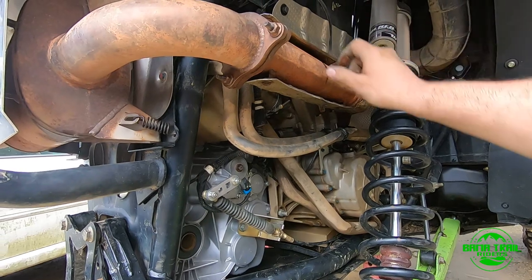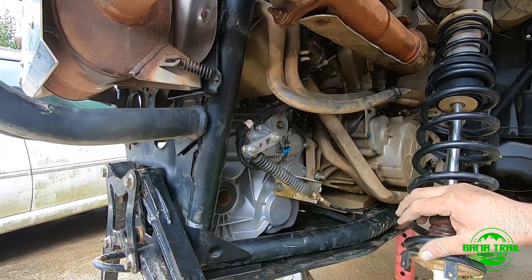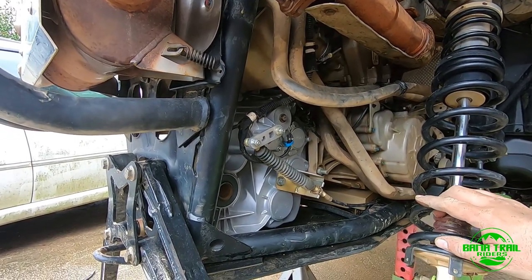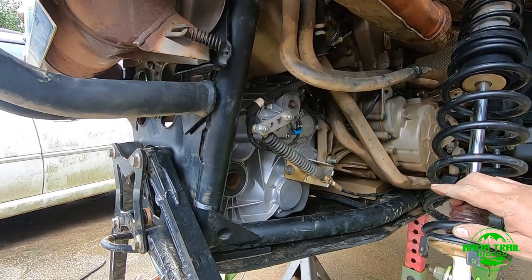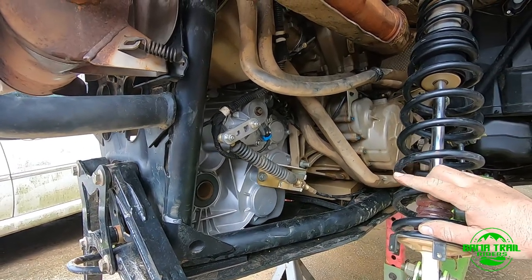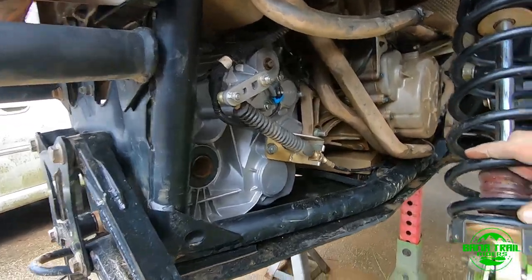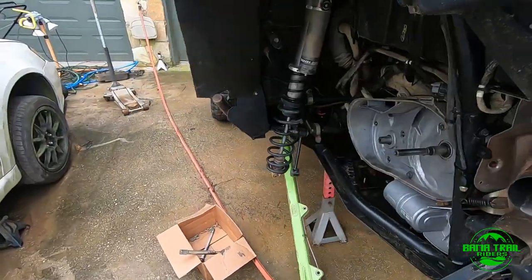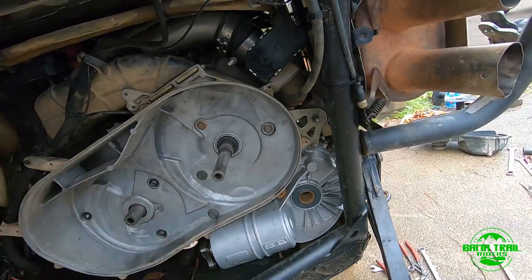We've done this in no time. It should be done in one night, but like I said, we got the problem on the other side of the case. It takes us roughly 30 minutes to put it back on. It doesn't take long to take the transmission out or in, as long as you know what you're doing. Then we're going to keep putting the parts in. We're missing the axles and radius rods. Most people know how to take suspension parts off. They know how to take the clutches off. To take the secondary off, you just have the bolt and let it slide right off.